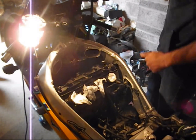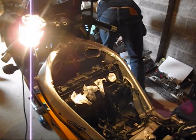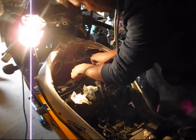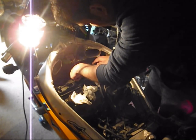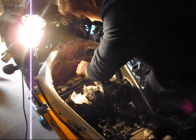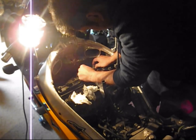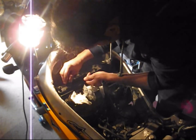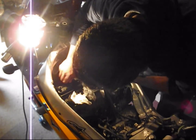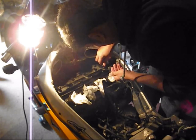So now let's bolt this back together, get the valve cover screws or bolts. I think there are six. There they are. They're covered in oil, so should be fine. Not massive, not doused in oil, but they're just lubricated, so I don't need to put any copper slip or anything of that sort in there. No chances of rusting. The heads have got some surface rust, but should be fine. Nothing life threatening in here.